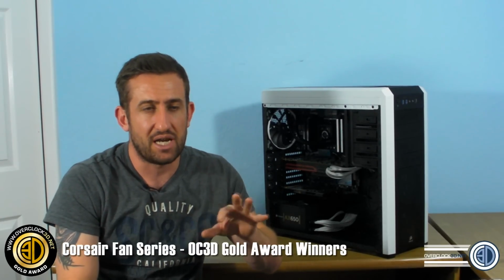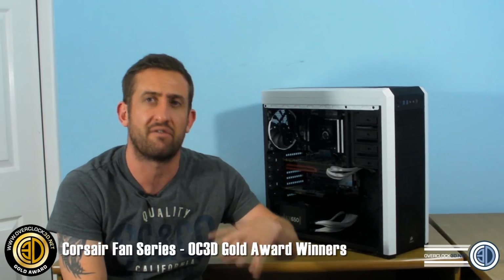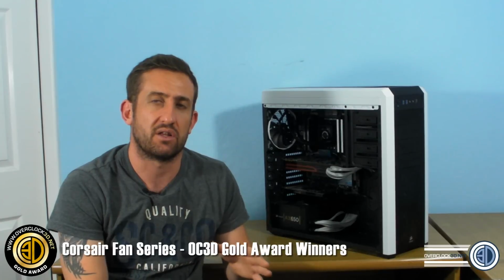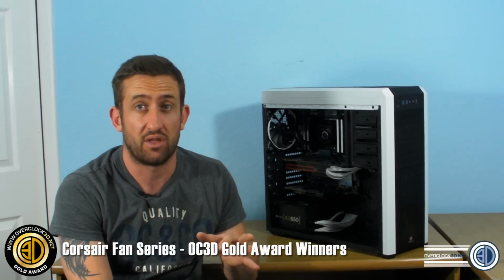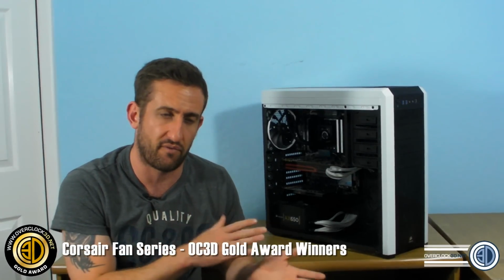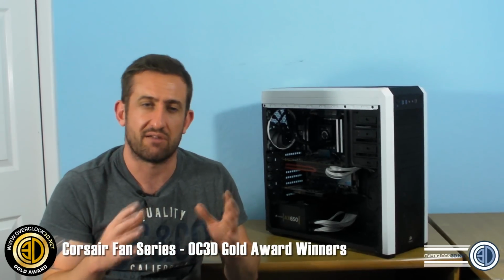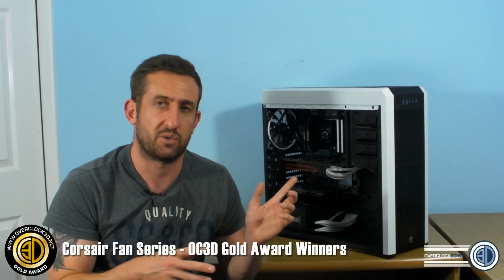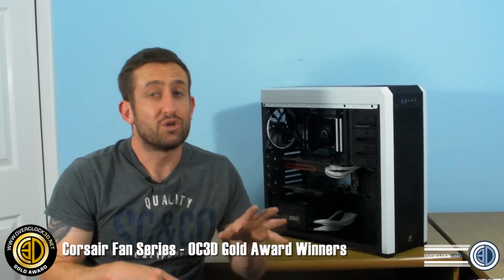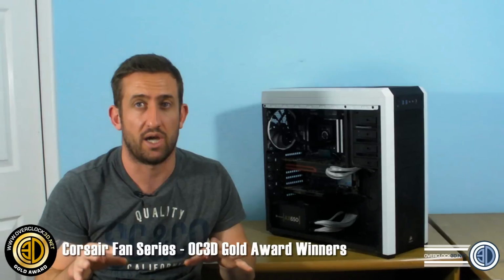A lot of people don't like the Noctuas because of the colour. The performance isn't enough and they don't like the colour. And the only fans that I've really rated, other than the Noctuas recently, have been the Scythe Gentle Typhoons, or GT, in the 1850 RPM versions, because the slower spinning ones don't really deliver the temperatures. But with the 1850 RPM fans, they're about 2 degrees warmer on the H100 at 12 volts than the NF120s. So the Corsairs are about half a degree cooler, but again, they're much quieter than those Scythes.